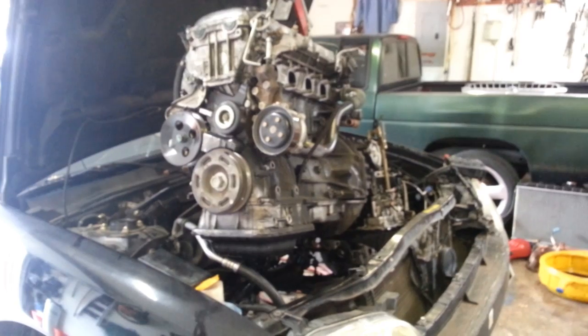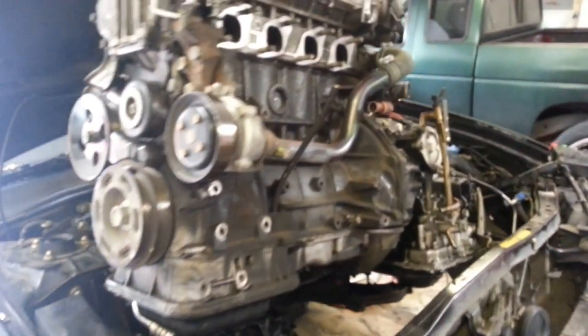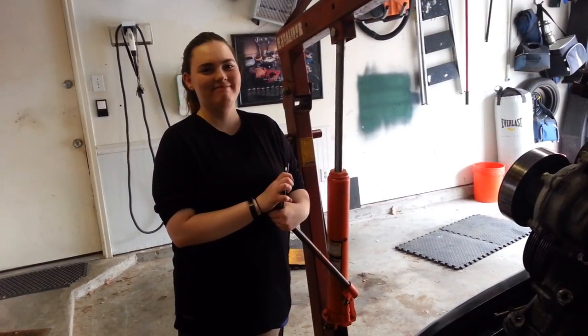Using my little tilter — there we go. I got the engine out and didn't even take the hood off. I didn't think it was going to be possible, but without disconnecting the AC I was able to pull the engine and tranny out. It wasn't too bad. I think I'll just pop the tranny off the new one and put them in as separate — it may be easier because it's pretty tight. It is out — engine and tranny as a unit. I didn't think it was going to be possible.